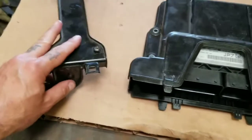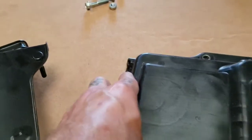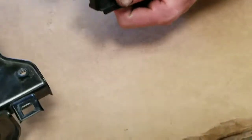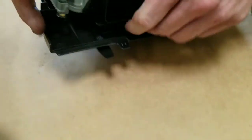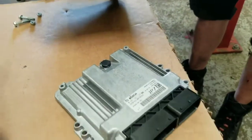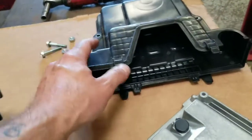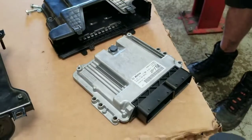We got the bracket off, and on the corners you have one little clip, another clip over here, then two clips on the bottom — one right here, one right here. The only clip you've got to take off is this one little corner clip, and once you get that off you can take the ECU out. The ECU is all set to be sent in to be jailbroken. Just take that one little corner off — you don't have to struggle with all four of them, just this one and the ECU will come right out. Any questions, shoot us a message.